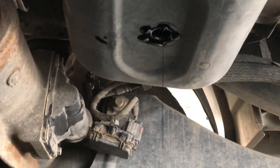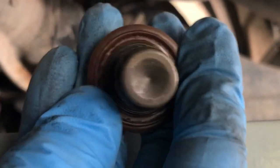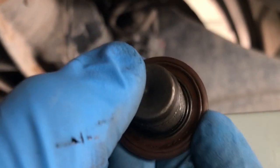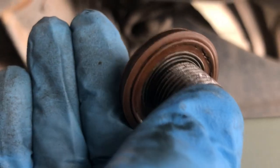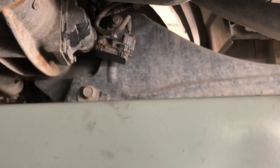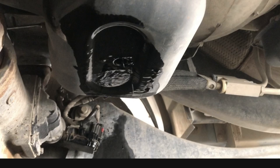I'm back under the truck. I've taken the oil drain plug out and cleaned it up. The gasket on mine is in real good shape so I'm going to reuse it. It's always best to really look them over — if they've got any nicks or tears you should replace it; they're pretty cheap. I don't happen to have one here, but there's nothing wrong with this one. Last thing I like to do is take a little brake cleaner and clean the bottom of the oil pan where it's going to be sealing, because you've got dirt and all the oil that's been coming out.